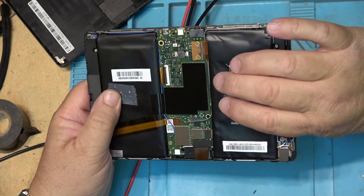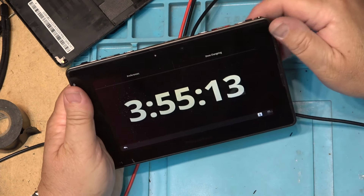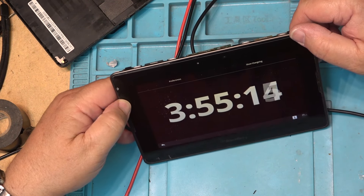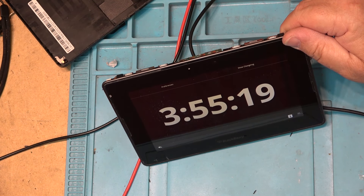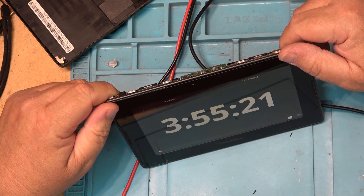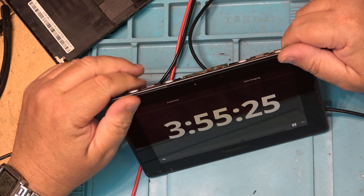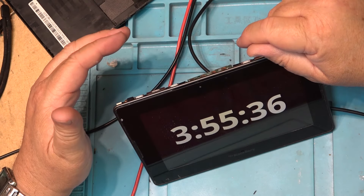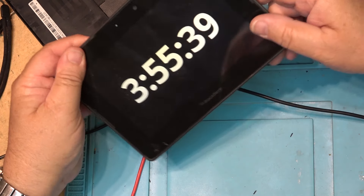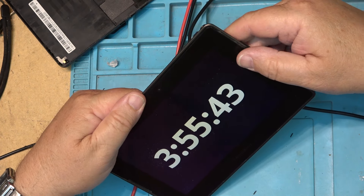I just let the gas out so at least I can put the back on it without it popping the screen off. But I'm not going to be putting this thing back into service — once the batteries have gassed like that, you don't know what else is going on. It actually shouldn't try to charge them; the battery management software should cut them off. But it's running on battery right now, which is odd.